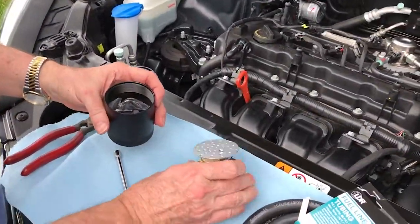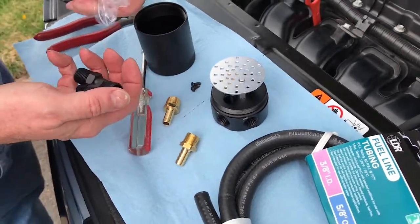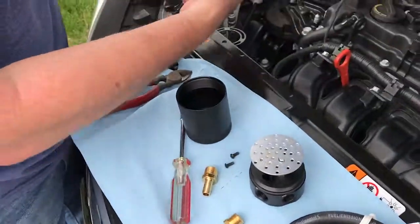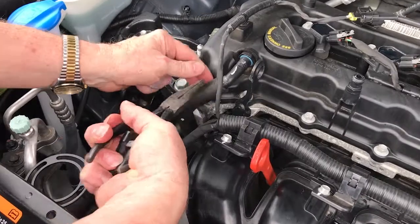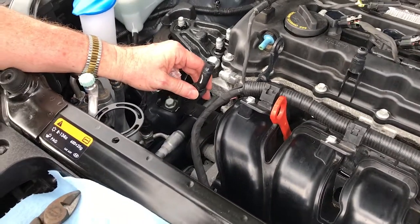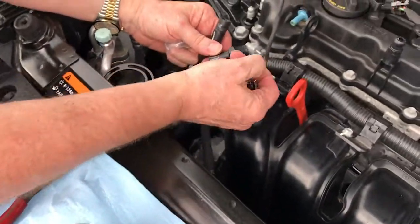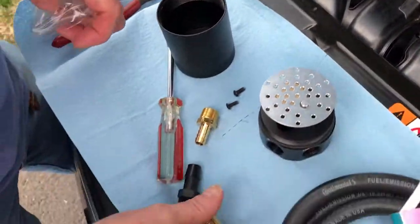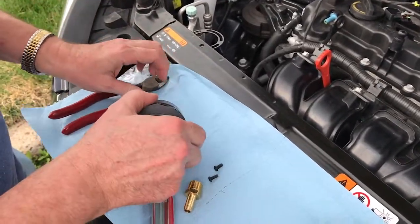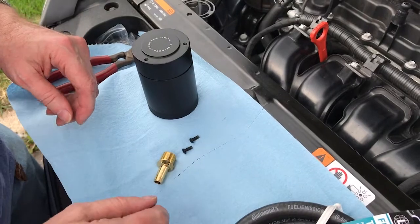After having installed the bracket, what I want to show you is that I decided to discard the plastic units that came with the original part — not because they're of lesser quality, primarily because the connection itself, as you take it off, you'll notice that it's 3/8-inch inside diameter. You really need a barb that will actually fit the 3/8-inch diameter. The Mishimoto's are half-inch, so they really don't work. So let's go ahead and assemble the unit back together, threading the new units on with some tape.